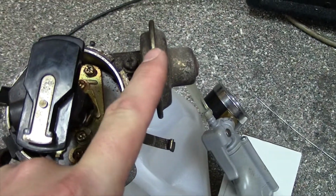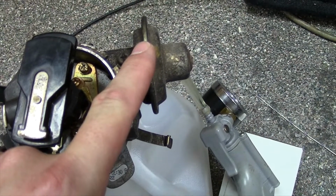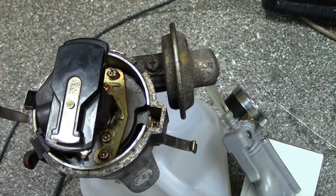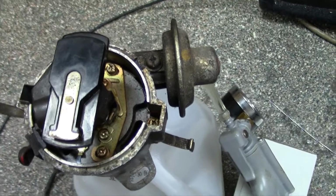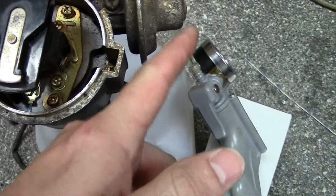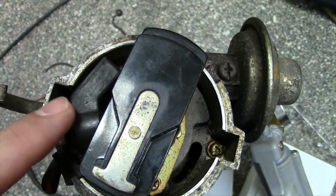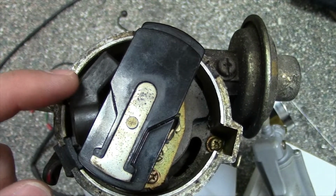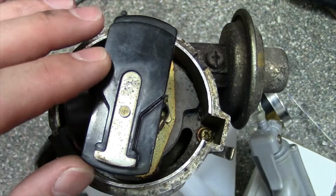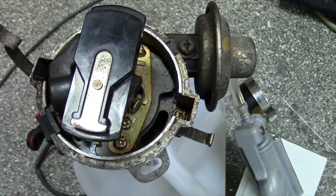This is your vacuum servo or modulator, which one you'd want to call it. It works very similar to how a transmission servo works, like a vacuum modulator on the side of a 3N71B transmission, for example, in a Z car or a truck. What it does is you get a vacuum into it, and it changes this plate location right down here, which changes your pickup location, and that's what actually changes your timing, your clock, so to speak, for your electronic ignition module. And I've got a whole video on the electronic ignition, how that works. I'll post a link in the description below for those that might be curious.